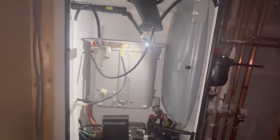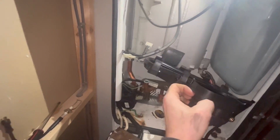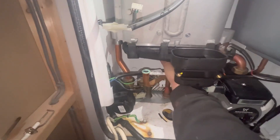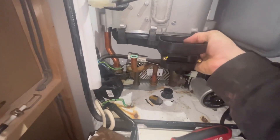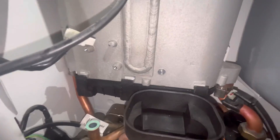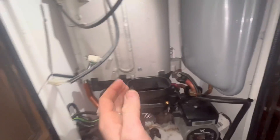There is a new sump and there are two different types of these — make sure you get the right one. It's for a combi. All I've done is put some silicone grease around the edge. I'm going to push it in, feeding it around the back first. You need to angle the back and push up, and it will click. You want to hear a click when you push it in — I did actually click the back in, then the front will snap on.